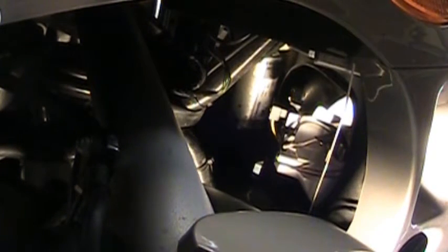So anyways, we've got this first bulb on this bike, this lower bulb here. There's two of them, one up high and one down low. The one that's up high is the low beam. So you have to pull off the little tabs that are holding it in. For the sake of the video, I can't see what I'm doing at all here. Okay, there's a couple little pinch tabs here. Pinch that together, and pull the bulb out.